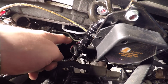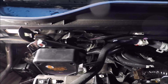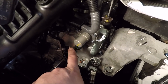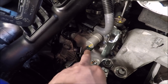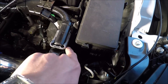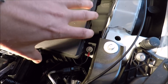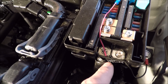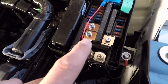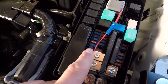After you get that done, I have the power and ground from the sensor and the power and ground from the converter tied together at that pigtail. I got the power and ground coming over here behind the battery box, coming out right here. I originally had it coming from the reverse switch and the ground right here because this is switched, but I didn't like the look of it and I wanted to get it in here and fused. So I came right here and got the ground right there. For the power, I actually came up through where the battery comes in — there's already a little slot in the wire, but I had to drill a tiny hole here, because if you just try to loop it over, you're pinching the wire pretty bad since the lid has a groove that goes all the way around with a gasket to seal off this area. Brought the wire in and came over here to this add-a-fuse.